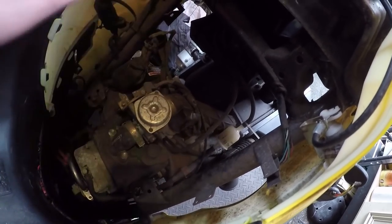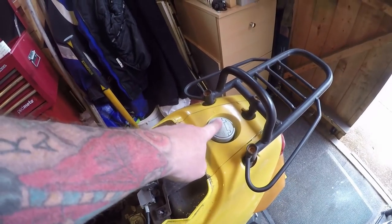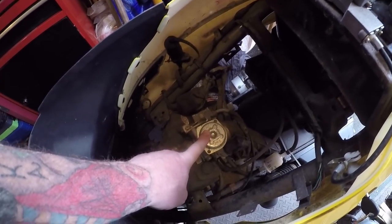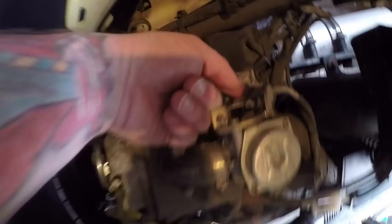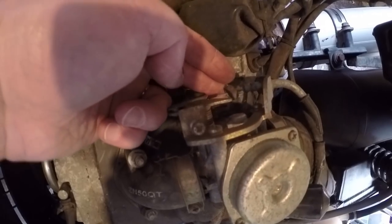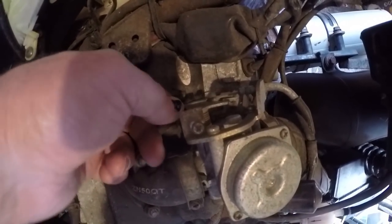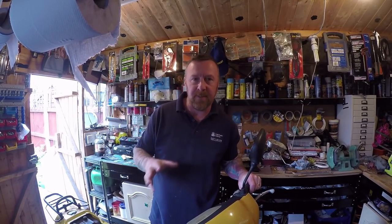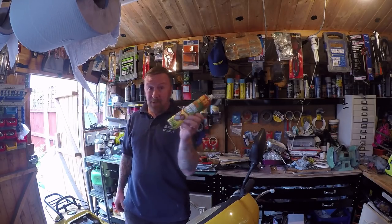Off — suck out all the old fuel, drain it all out. Put a little bit of pipe here and suck it out, let it drain out that way. Clean the carburettor. Look — that shouldn't be loose like that. Can you see that? That will mess around with your idling. So I've already said it before: you must go around these with WD, GT85, cheap pound land stuff.